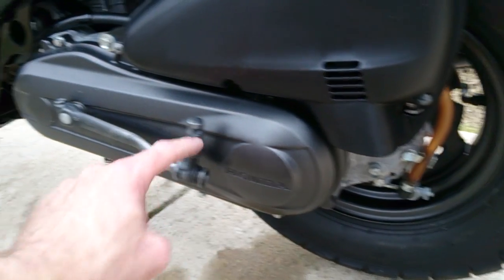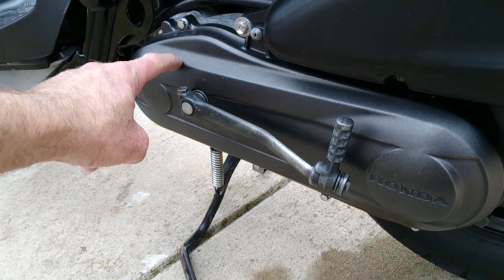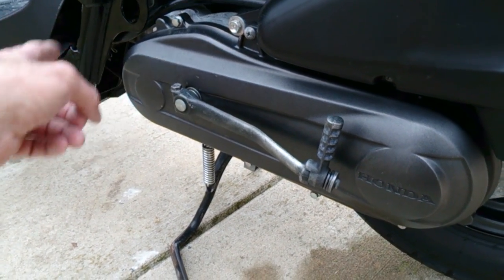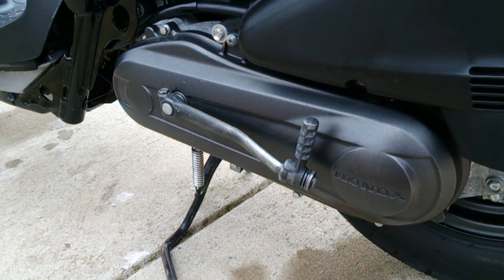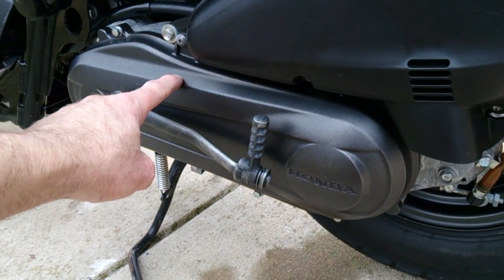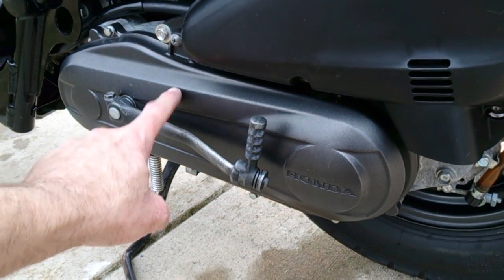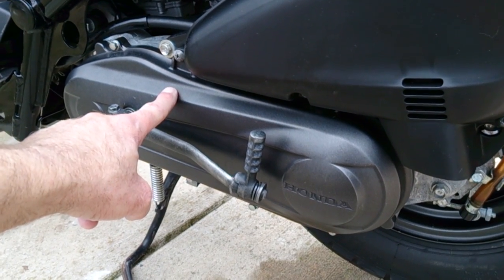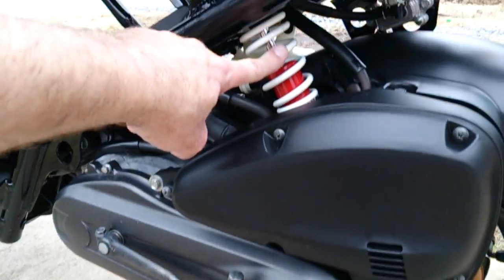The Dr. Pulley's been dialed in. In the front, I have a Polini variator, currently running 5-gram Dr. Pulley sliders. I'm including a lot of sliders and a CNC variator along with the original equipment with this bike, so it can be really dialed in. There's a Polini Kevlar belt on here also. The 5-gram sliders and the Kevlar belt both have just 600 miles on them, so the bike was serviced not long ago. Daytona rear shock up here.